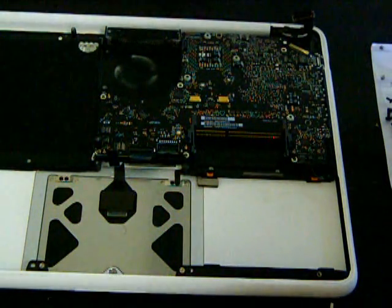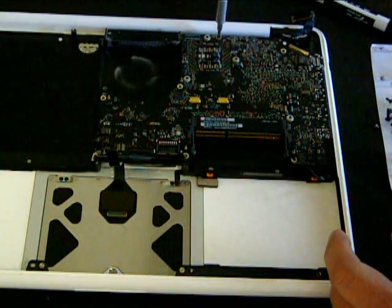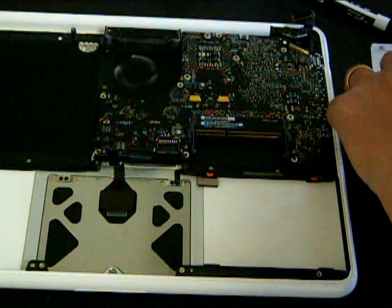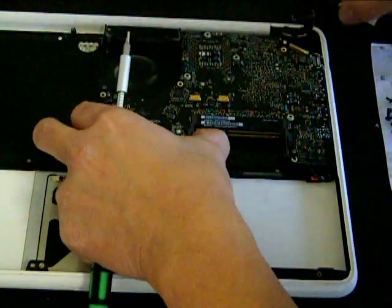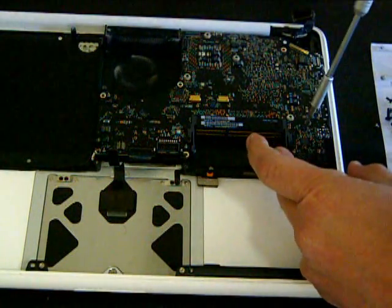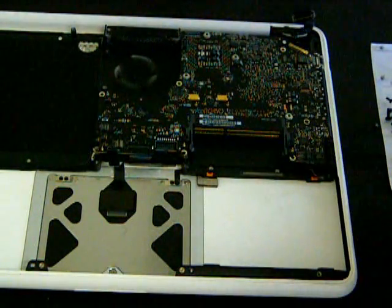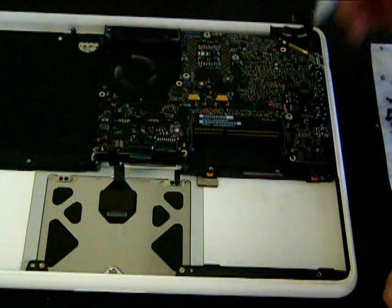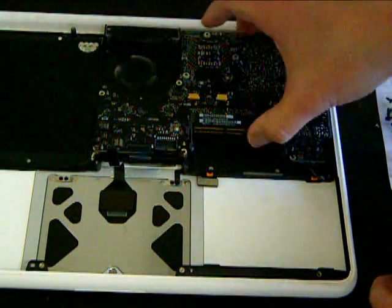I am sharing this with you so that disassembly and reassembly will be fun for whoever wishes to open their machine. Right now when I pull out the DC jack — that connects to the board — just be careful not to yank it too soon; you may damage a part there. So this is the logic board — I just took it out. That's the correct part number if you want to replace it — make sure you match the part number when you purchase from the motherboard supplier.